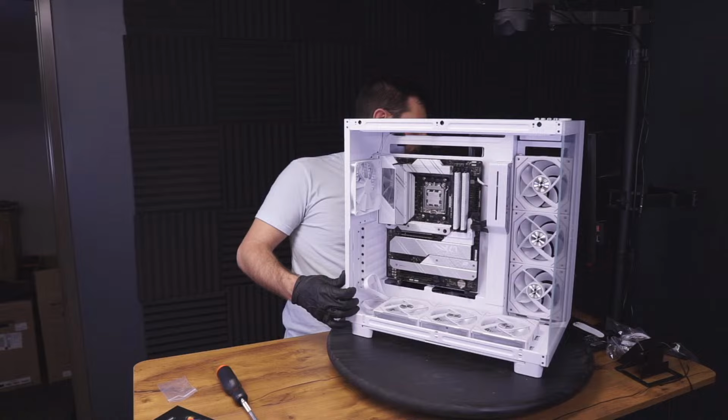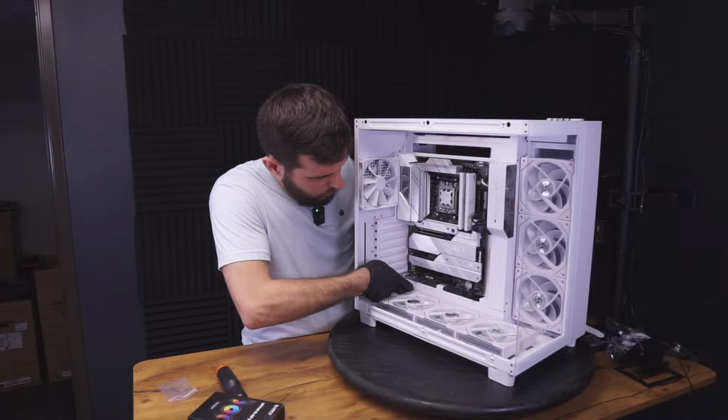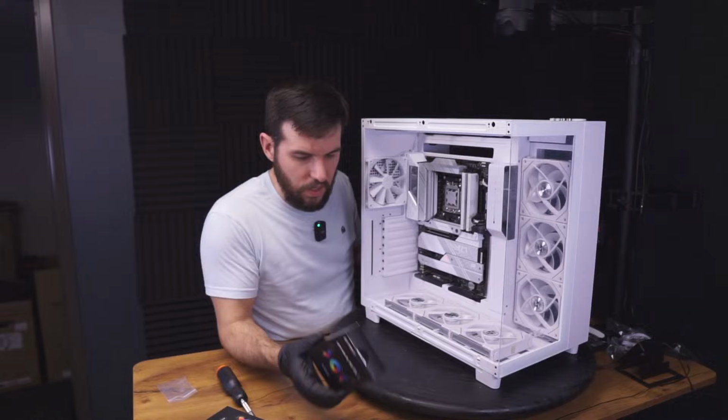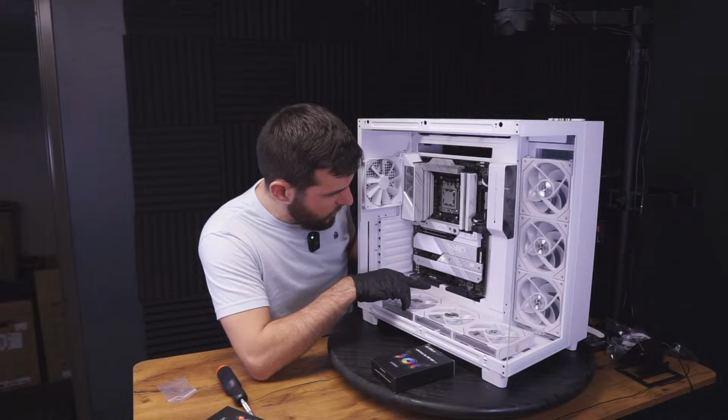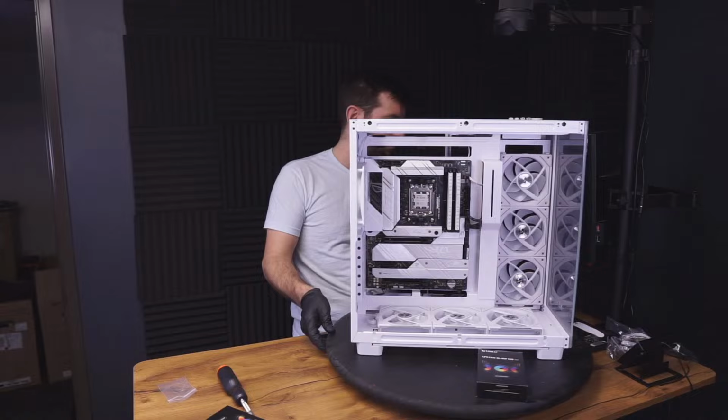So if I wanted to add fans like that, I'd need a USB hub. If you buy these as a three pack, it comes with the hub. So it'll have the connections on it. It'll have a couple of SATA power cables that you have to connect in, and then you'll have to connect it into one of these little internal USB 2.0 ports, and then a system header port. That's it. So no, you don't need to buy a USB hub. You just need to be able to plug it all in.